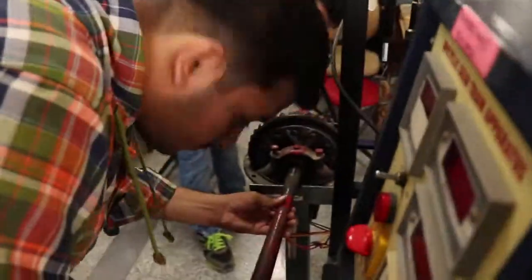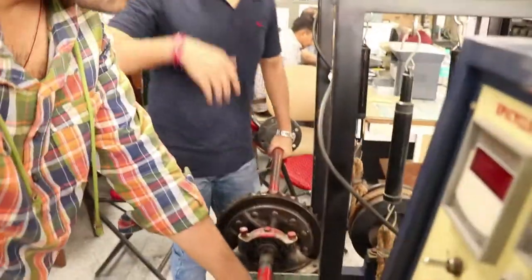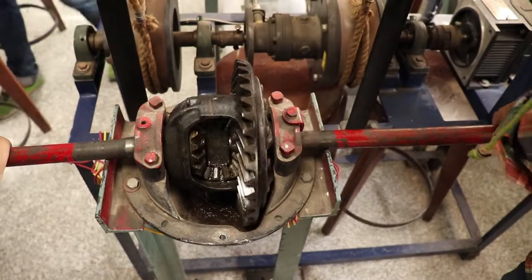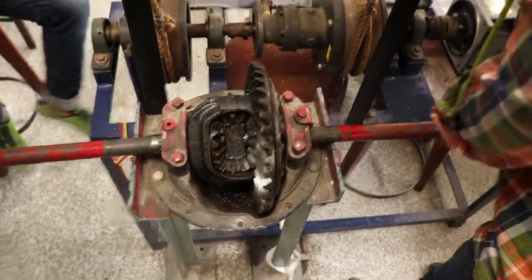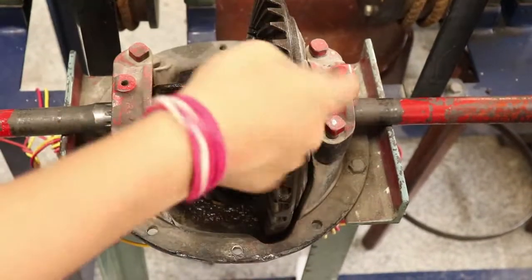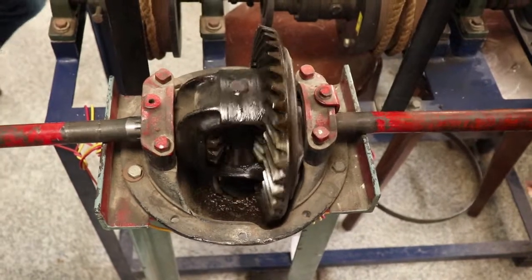Now we'll join the shafts and show how the differential actually works. If both shafts are required to have the same power and rotate at the same speed, you can see there is a normal rotation. But if one tire needs a higher speed and the second tire needs a much larger speed, then this is the mechanism: one shaft can be locked while the other shaft can be rotated. If one rotates at a much smaller speed than the second shaft, it will rotate like this. The shafts can move, but there are unequal velocities of both shafts. These gears actually help in differential power distribution.